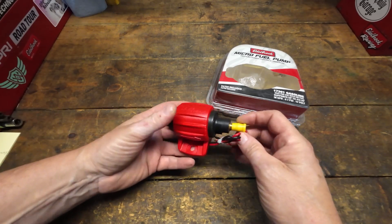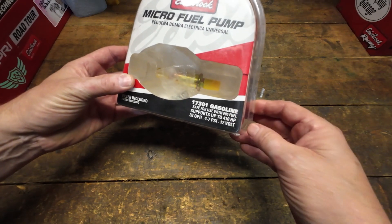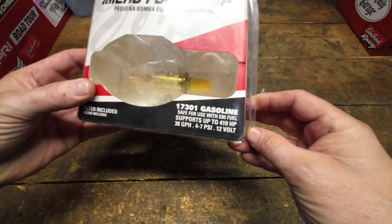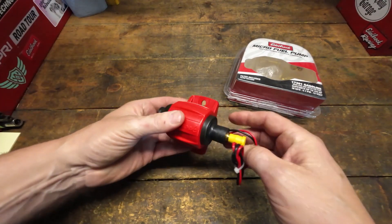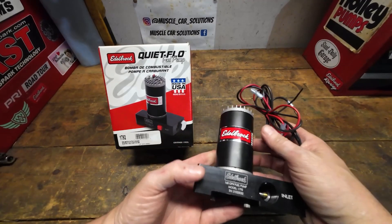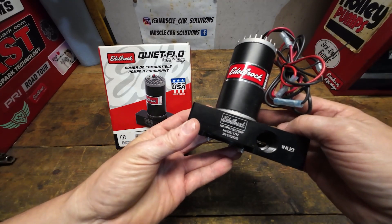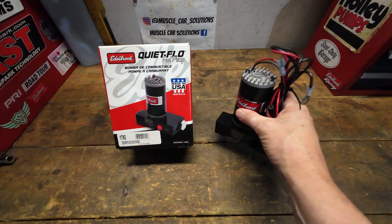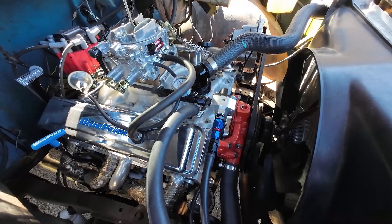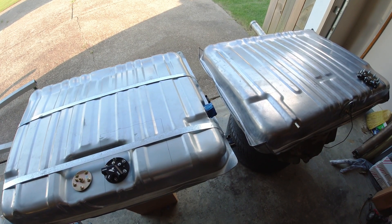An incorrect pump is another issue. Running too small a fuel pump — like small pumps from Edelbrock that are great for low horsepower, low RPM, non-aggressive applications — won't work for higher-demand setups. You can't expect a 60 or 70-dollar pump putting out only 38 gallons per hour to meet what you're trying to do. Get the correct pump to match the power delivery you're targeting. Not enough fuel delivery at the right time is a big one — it often shows up as falling on its face at 4,000 RPM, or a stumble and hesitation, even if it idles and cruises okay sometimes.